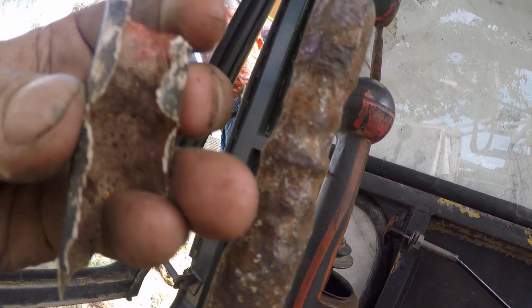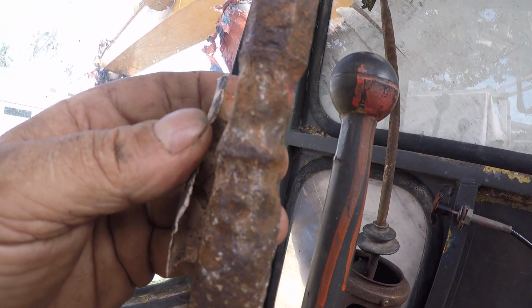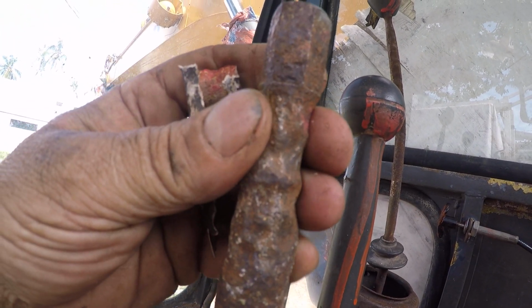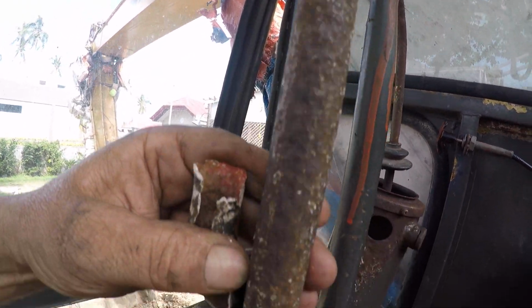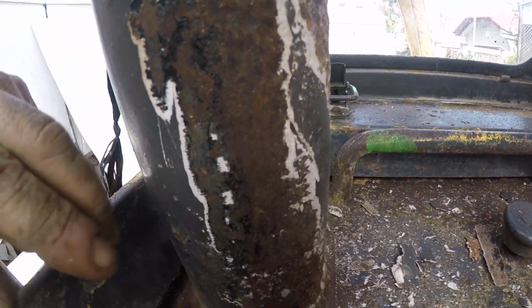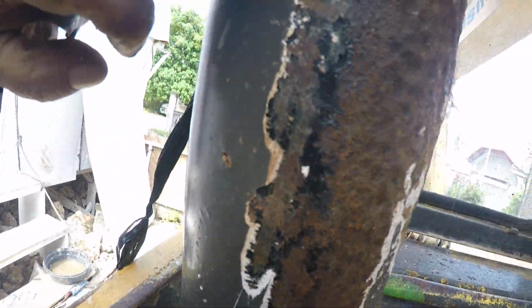Now I'm going to take that off, and you could see how it's a perfectly formed fit. So the Bondo work is excellent, except they put it over a rusty surface that was never primed, and it's all the way around everything. This was almost 1/8 of an inch thick down here, and now I brought it down to the bare metal.